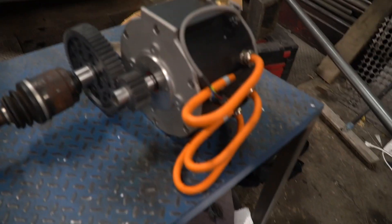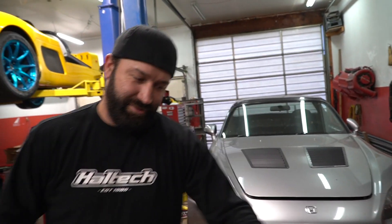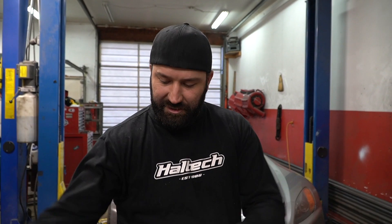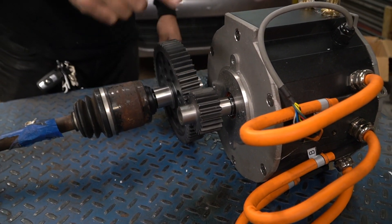So we should have 200 horsepower - 100 horsepower each motor. Notice I said motor, not engine. We do have to differentiate because there is an engine and a motor on board. So 100 horsepower per motor. The torque they'll output is 560 foot-pounds of torque. What that's gonna generate to you at the wheel I don't know - we'll find out when we do the dyno. It's probably gonna be 300 or 400 foot-pounds. What's the drivetrain loss? The motor itself puts out 90 foot-pounds, but because we're reducing on a 3-to-1 ratio you can multiply torque, but I don't think it's a straight conversion.